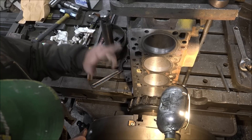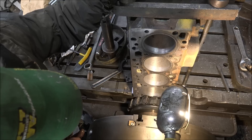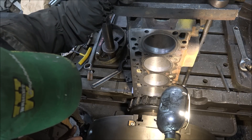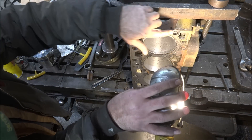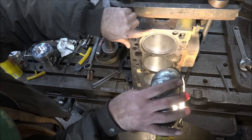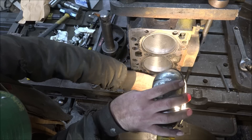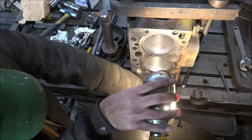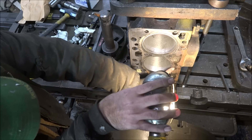A fine example of why you may not want to have your head milled if you blow a head gasket. You can get on one of these unless you're planning on pulling the block too. You can see the mill touches here, obviously falling down this side, fades out over here, touches right there on the outside — little bosses — cleaning them up. But all this is low over here.